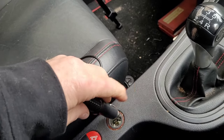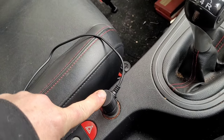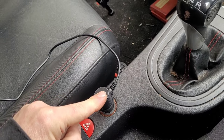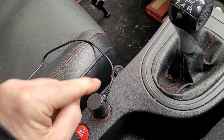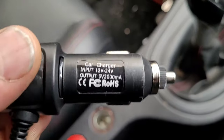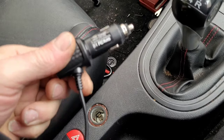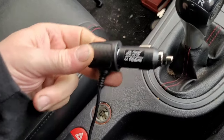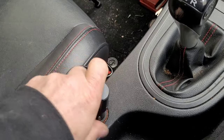The 12 volt plug goes into the auxiliary socket. There is a way of hard wiring these — I've shown it in a previous video, I'll leave a link to that. You don't want to cut the plug off because on here it's 12 to 24 volts in but 5 volts out, so you can't cut it. But there is a way of doing it where you can still use your accessory socket while the unit is hidden on the dash.